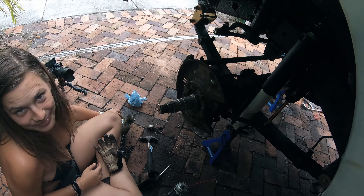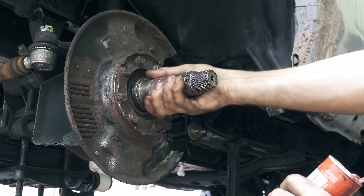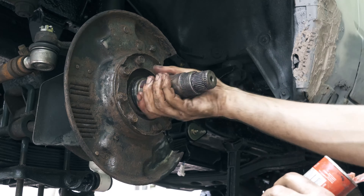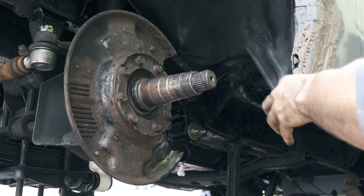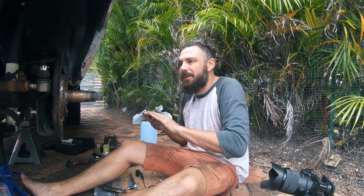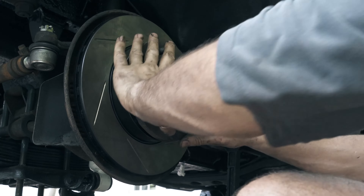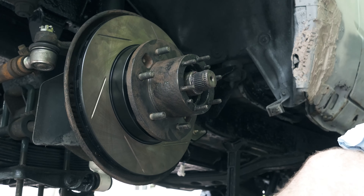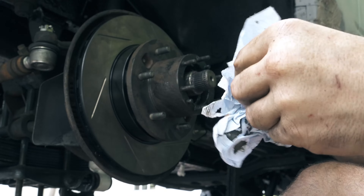Sophia's been cleaning up these disc brake protectors while I've been over here installing the studs. You really can't put too much grease on this — getting as much grease on there as you can is a pretty good plan. Doing it in reverse of the way we took it off: first thing back on, let's put the fancy new shiny rotor on there. You want to try and push this back as far as it'll go so that the bearing fits really well. I'm also going to clean up the bearing and the washer and put new grease on those as well.